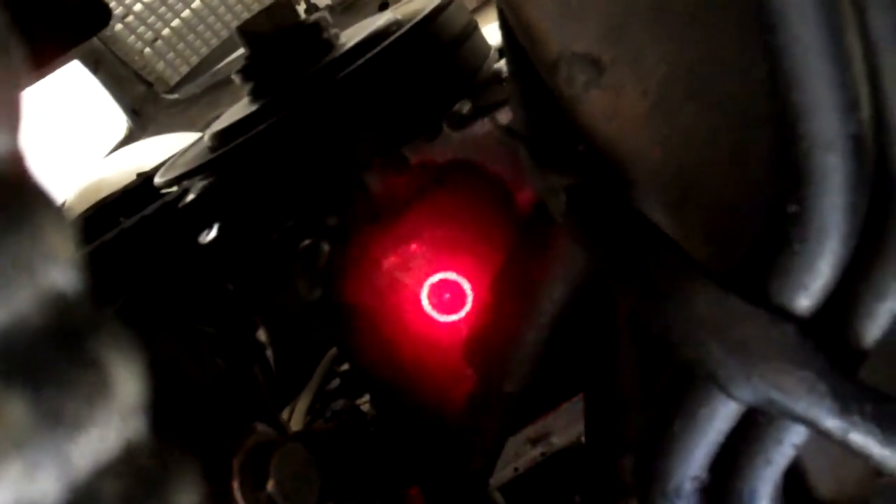Okay Stanley, the next thing we're going to show you is that there's a lot of oil here under the car. In the front area of the car, this is the engine compartment and we're looking from the bottom up. You can see that the power steering pump is actually wet with oil — I'm flashing the LED on the power steering pump right here and it's all wet right there. That's where the oil leak is coming from, from this power steering pump.